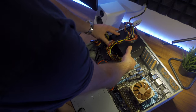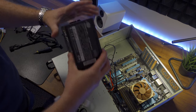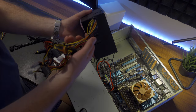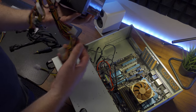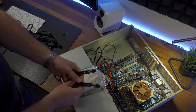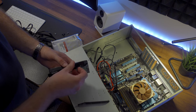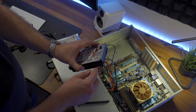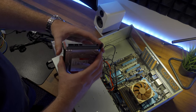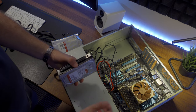Once that's free, I'll just lift the old power supply out. This is an old Cooler Master 500 watt power supply — it's worked absolutely fine with the existing drives, but with the new drive there's just not enough juice, and it's non-modular so everything's hardwired in with not enough SATA power cables. Now I'm attaching the rails and screws to the new hard drive — pay special attention to install the rails in the correct orientation. Once secure, I'll find a suitable location in the case to install the drive and route a SATA cable to the onboard SATA.